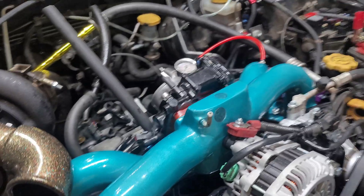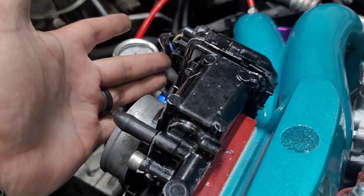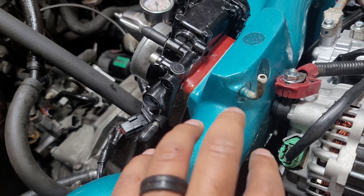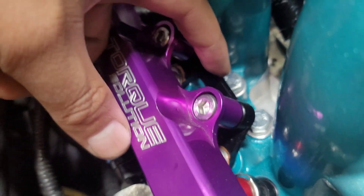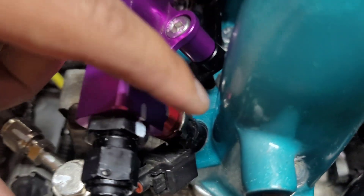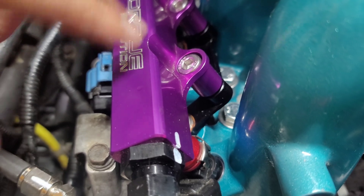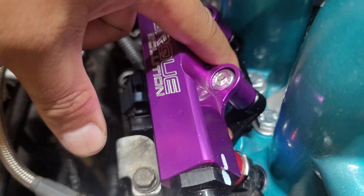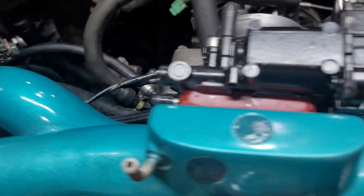Now that I've shown you the process to get a drive-by-wire throttle body fitted to an EJ207 — which is originally drive-by-cable — the next thing you'll need to look at is the fuel rails because the alignment will be totally different. There's a company called Illuminati that makes spacers for this, so the spacers allow your injectors from your STI or EJ255 to fit with the top fuel rails and mount properly.